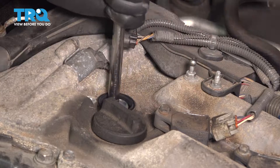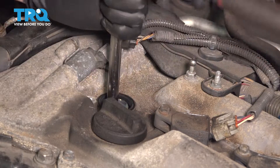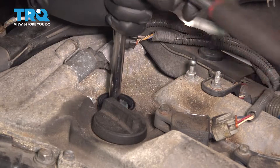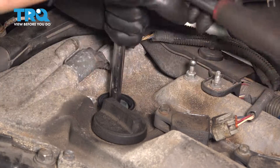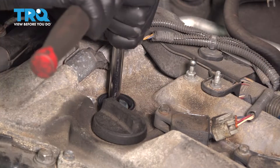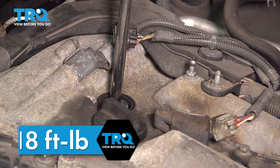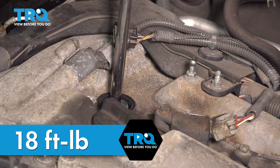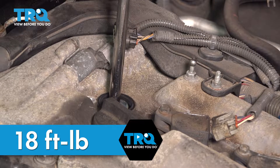And then, of course, we're going to come back and torque it with a torque wrench so that it is properly tightened. These do have a crush washer on the base of the threads, and crushing that washer properly is what's going to create a nice tight seal in the cylinder. That's snugged up. Let's get a torque wrench. The torque for this is 18 foot-pounds. If you don't have a torque wrench, all you have to do is give it about half a turn after it bottoms out.